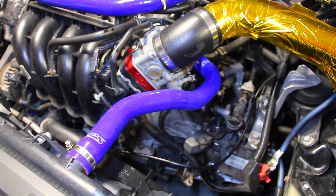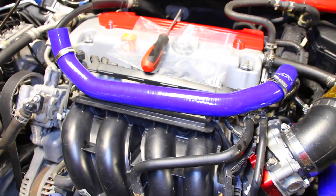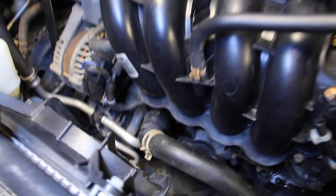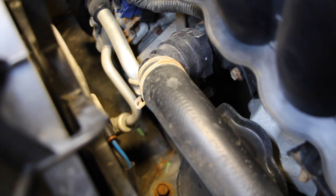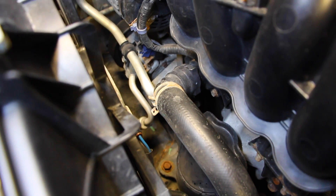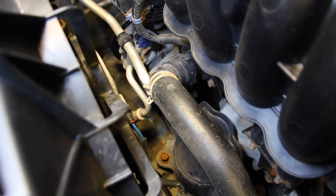There's the one hose done — that's the upper — now we're moving to the lower. The lower rad hose right here is connected by one clamp right before the thermostat, and if we follow it, it's going to be found underneath the radiator. We're going to have another clamp exactly like that on the bottom clip, and if we can't get to it by hand I'm going to show you how to use a special OTC tool to get that clamp removed.